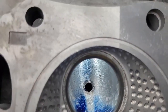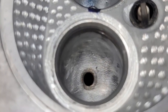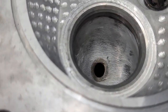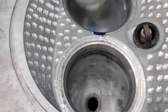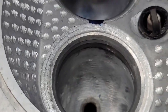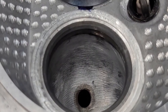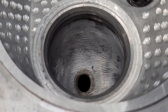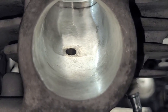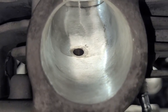A different view of that intake bowl — looks good. Okay, the exhaust. This is going to have your same valve job, correct? Correct. Now, the reason why I do the valve jobs this particular way — I use it like a funnel, because we know intake charge comes in through the tulip on the head of the valve. So on the exhaust, you're trying to push it out against something flat. If I can create a funnel to help get that exhaust out, we can evacuate the cylinder more rapidly. Looking down the throat of the exhaust, you can see it's night and day versus the stocker, and we're going to get into the flows in a minute.